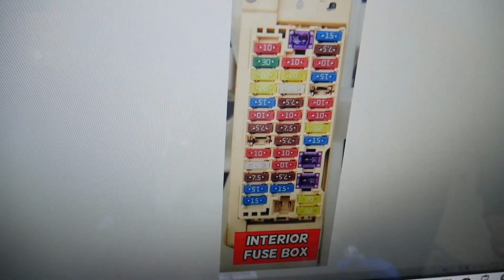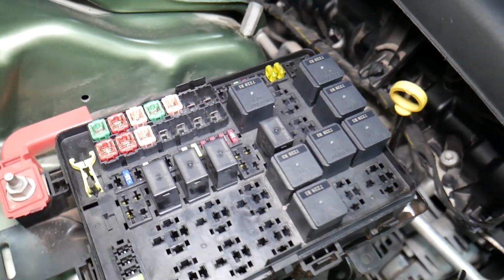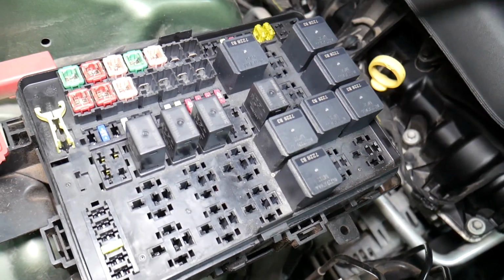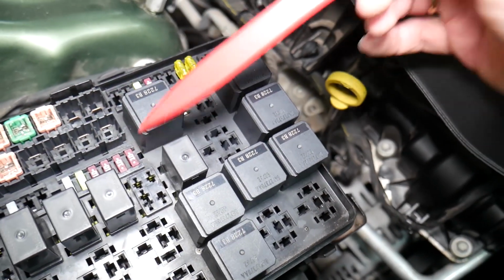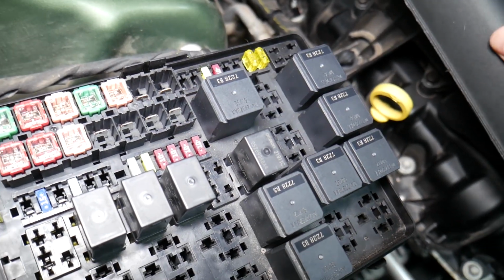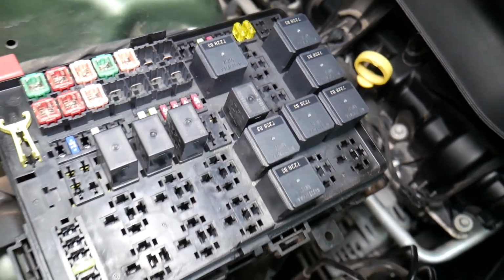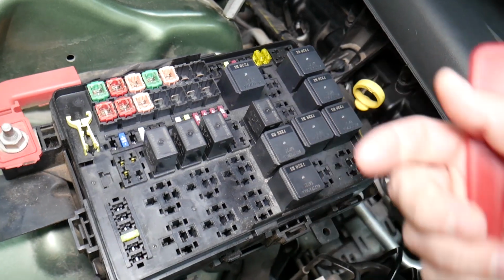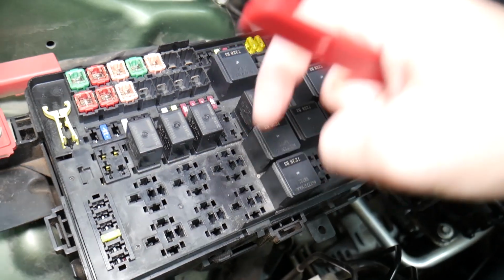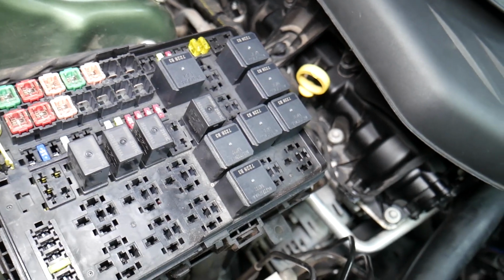Before we continue, let's explain why it's important to always test fuses and relays. Something else as well, common mistakes people make. Sometimes you may think that a fuse is good, or you cannot actually see if the fuse is clearly burned, and in that case you may put the fuse back and you may end up spending money and time on parts you don't need, and all we had to do is just test the fuse. So we'll put a link in the description of the video below on how to test the fuse. It takes only a few seconds to find out for sure if it's good or bad.